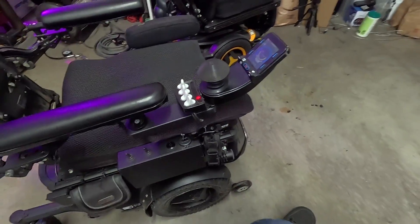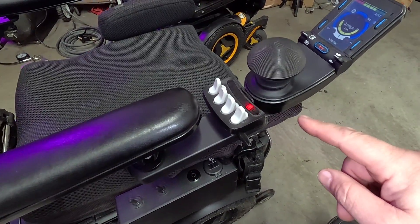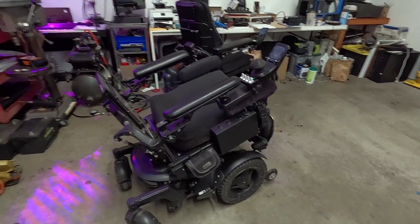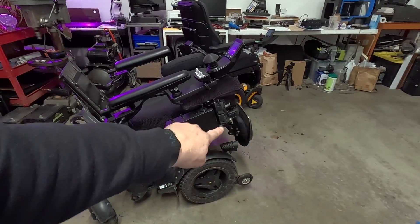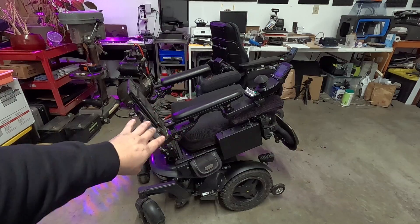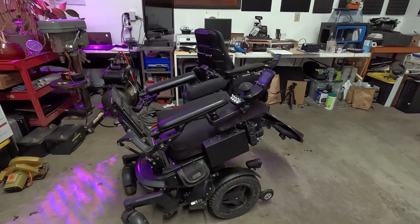Wait for all these to turn green. There we go — now let go. You'll see we've got a little dancing red light right there. Then to start the process, we want to hit button 4, which is going to be right here. Now the chair is going to run a bunch of its actuators — it may not run all of them to full extension, it depends on what it decides needs to happen. You can see there the leg rests are going. You're going to see some errors on the screen during this process — completely ignore those. We're going to let the whole thing run for maybe two or three minutes until we hear an excruciatingly loud beep coming out of the joystick. It may seem like it's not doing anything, but just wait and it will eventually do that.